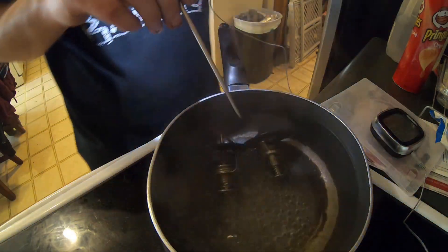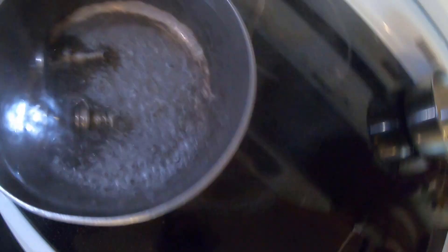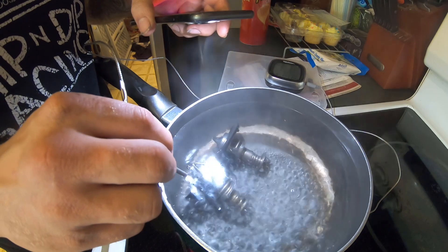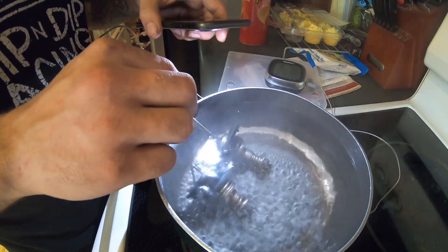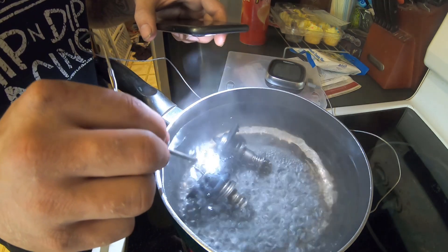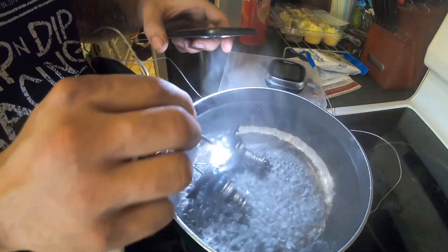Looking at the top neck of it — the OEM is a whole lot more open. The openings are skinnier and taller, so coolant flows out faster. On the aftermarket one, it bottlenecks because it's flat. And there's webbing on this thermostat that further bottlenecks the flow and causes turbulence — which you don't want when you're trying to flow coolant to get rid of heat.